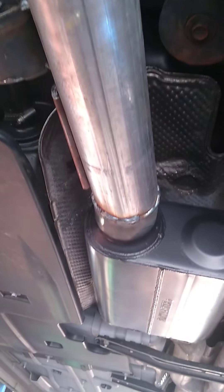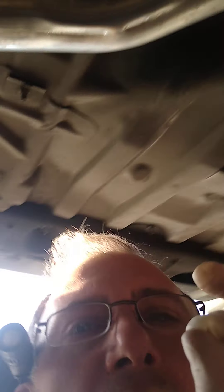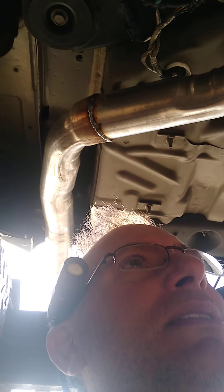So I ordered something else and went with Z Automotive. I went back over my job and used a small piece of welding wire to scrape the terminals and make sure there was no oxidation or corrosion. Then I plugged in the dummy plug on the driver's side and the module on the passenger side, lowered the car, cleared the codes, started it up — no instant code.